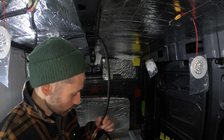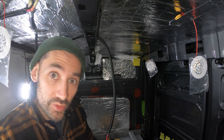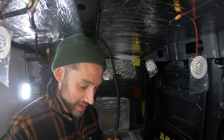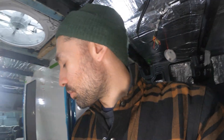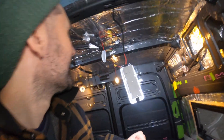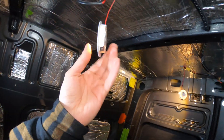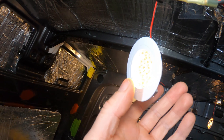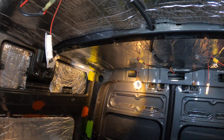That's all connected and heat-shrinked up. Just need to clip these wires up with some foil tape, then we can plug them in and test them. Will we have the first light in the van? Stick a 10 amp fuse in the fuse board — that's what the boss said to go with. Ten amp going in... we've got lights! Except that one — oh wait, it is working. These are touch LEDs — you can turn them on and off independently, which is pretty snazzy.